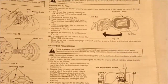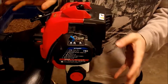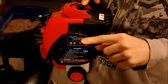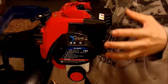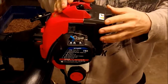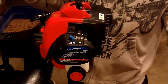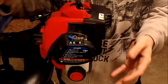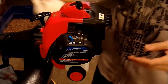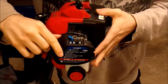To get it ready for this year's mowing and trimming season — here is my Troy-Built trimmer. We're going to be doing a little bit of maintenance: checking the air filter and spark plug. Make sure the engine is cooled, not hot, when you're doing the tune-up or maintenance. Also, please make sure you disconnect the spark plug boot just to be safe. On this side, this is considered the air box attached to the cover handle. We do have a little bit of oil leaking out of here, but that's normal — that should be fine.